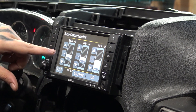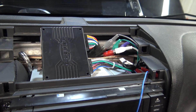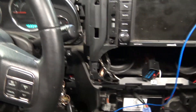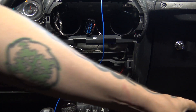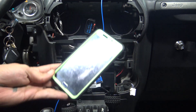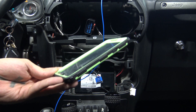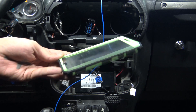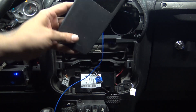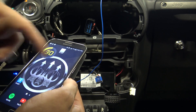With the DSP, we'll be able to set everything at zero and flatten everything out with the new AXS DSP. I've already gone through and done a little bit of a tune. I'm doing this with two phones because I wanted to tune the head unit with Bluetooth — when you play Spotify off your phone via Bluetooth, it sounds completely different than the radio, and we normally listen to Spotify. So I needed one phone to run Bluetooth to the head unit, and another phone — my old phone — to Bluetooth to the DSP. You have to get the app for the DSP.